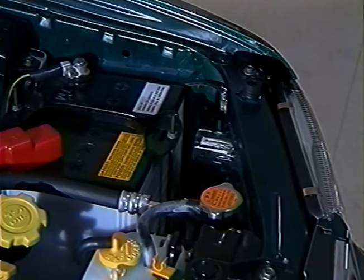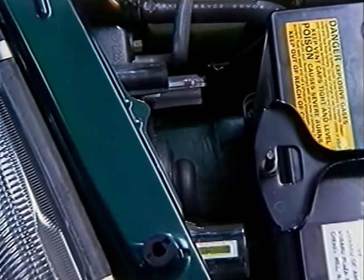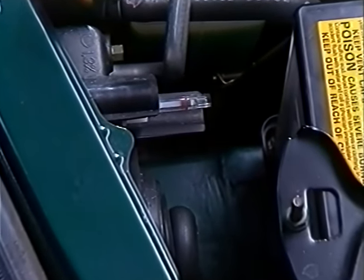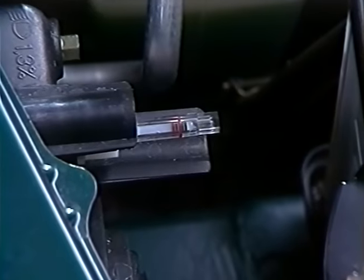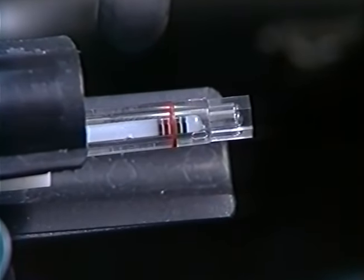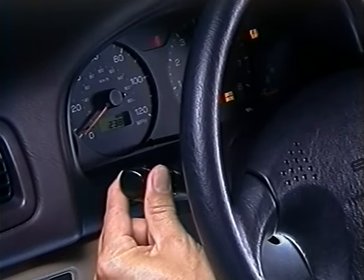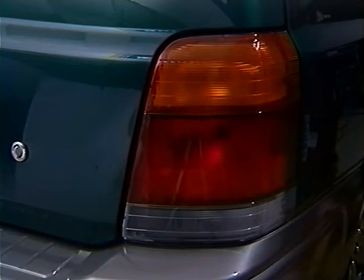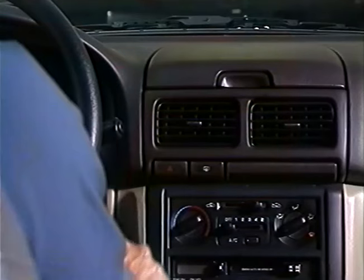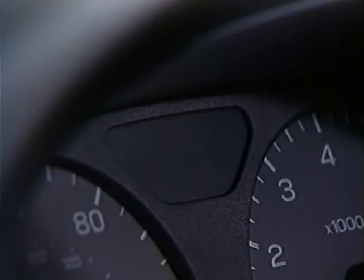As with previous Subaru vehicles, the headlight assemblies have a built-in alignment system. With the vehicle parked on the level, check the gradient on each headlamp assembly. For proper horizontal positioning, the index mark should align with the center line of the gradient. For correct vertical positioning, the air bubble should be centered in the sight gauge. Now turn the lights to the park position. Check that the parking lamps illuminate. Press the hazard flasher and make sure the signal indicators are both working.